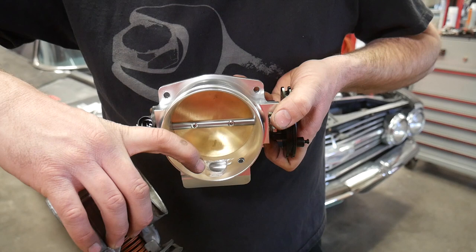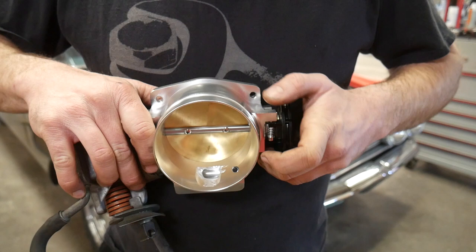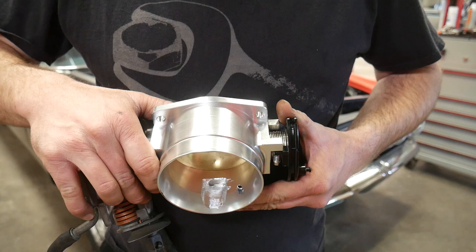On this one here, you can see down in the bottom how wide that opening is. When I started, there was about a 3/8-inch diameter hole there, real similar to this hole here on the side — that's for the crankcase breather. But there was a hole about two of those wide over here, and it was causing a very dramatic whistling sound.